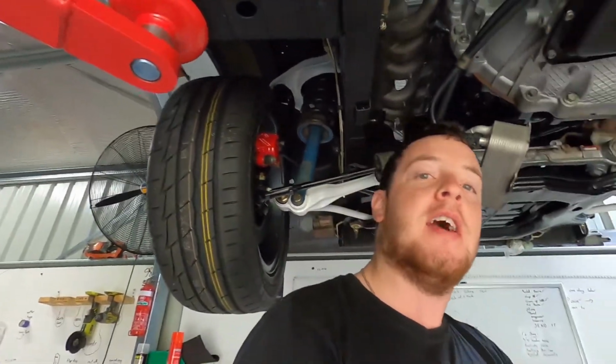So what we're gonna do is I'm gonna pull the gearbox back out, pull the engine back out, and we're gonna cut that little nub out and make a piece of plate that sits the same contour as the rest of the K-frame over it to pretty much get rid of that nub. I was told I could hammer it down, but I don't think I'll be able to make it look good and I want it to look good for engineering. So yeah, that's the next plan of attack. I probably won't record pulling the gearbox and the engine out again, but we will get into fixing it, which you'll see about now.